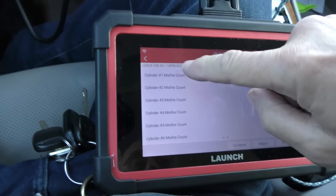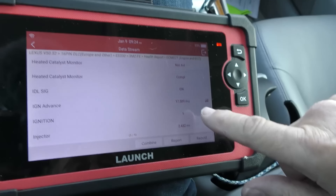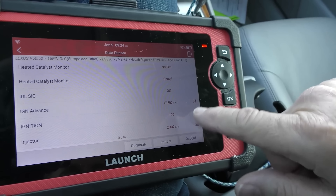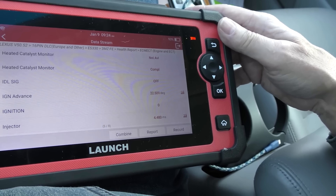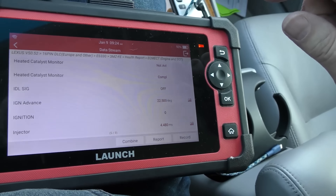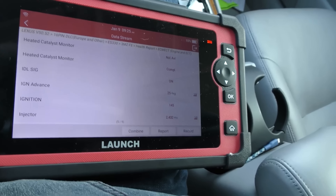In this case it doesn't really matter that the car is 18 years old — it's only got 75,000 miles, and that's nothing on a Lexus. You can see the misfire counts: zero, zero, zero, zero, zero, zero — no misfires at all across the board. It's stable at 17.5 degrees, not moving at all. Until we rev it up, in which case it goes up like it's supposed to, then as it goes back down it will return to where it was before. All the data shows me the car is running perfectly, and that is indeed the real mileage on this car.